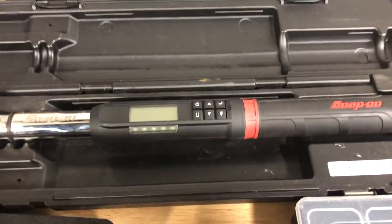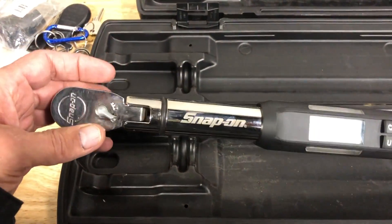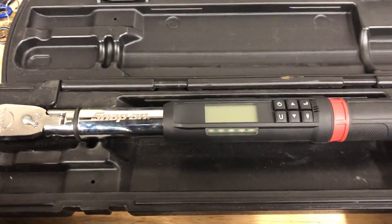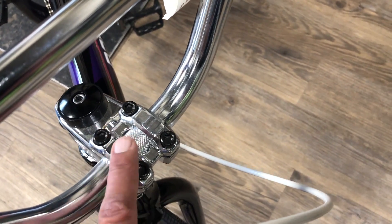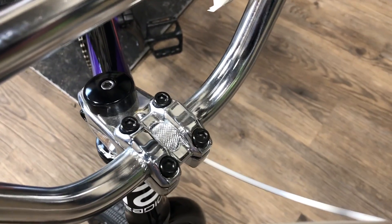You've got these guys that are kind of your top of the line — digital. So you've got this BMX bike here, and just out of curiosity I looked on the Profile website. They have a standard stem bolt there, a six millimeter bolt, and they call for 8.5 Newton meters.